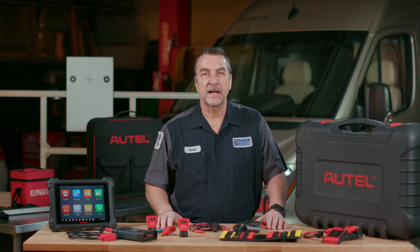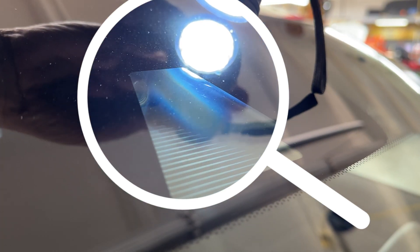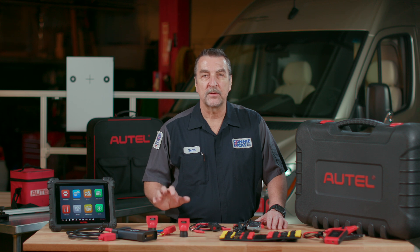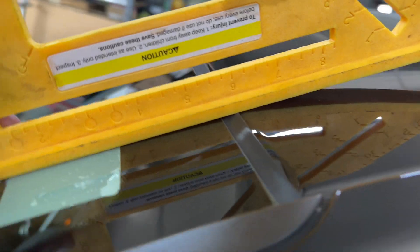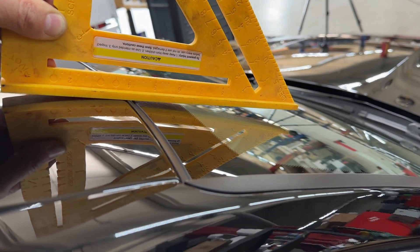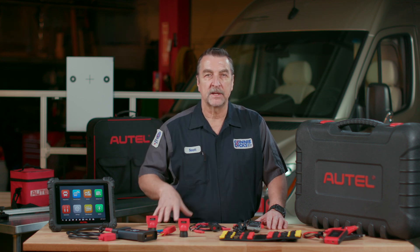This includes cases where you're cleaning the natural off-gassing that occurs on the inside of the windshield ahead of the camera. Here's a tip: from the outside of the vehicle, use a flashlight and shine it in at the opening opposite of your viewpoint. This will allow you to see if any of that off-gassing film exists — if it does, it's time to sell a cleaning and calibration service.